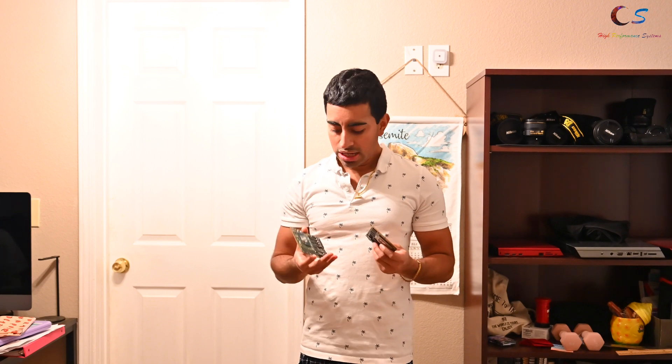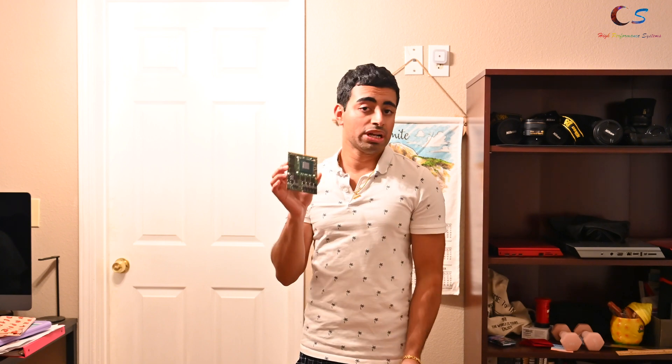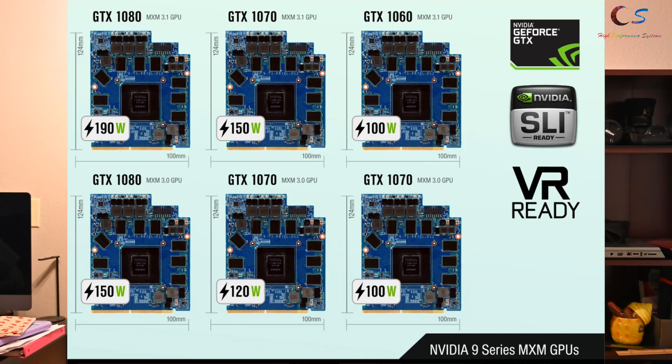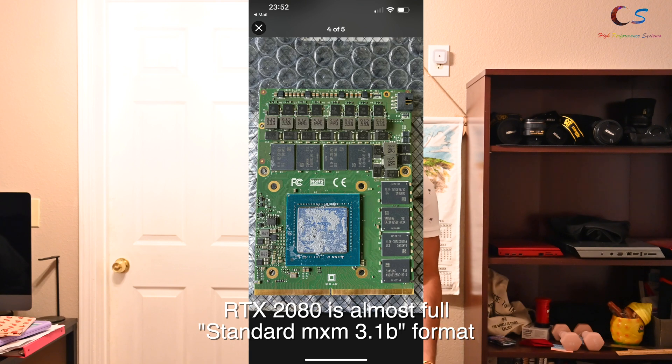I'm here to say that's not entirely true from what I've noticed. I have in my hand a GTX 1080 desktop-grade MXM card. This is a 150-watt TDP card, and if we put them side-by-side, it's almost the exact same size — the only difference is the length. A MXM 3.0B has an 82x105mm size; this one has 82x113mm. You can actually reuse the heatsink from one card for the other. This card does have a 4-pin power connector, but that's not too much of an issue. All those crazy designs weren't necessary — this is a 1080, and you can see those other 980s and 1080s had these weird designs. Laptops are moving to thin and light designs, and unfortunately these standards are pretty much dead.